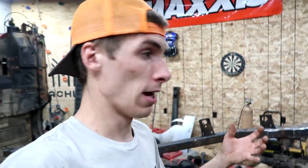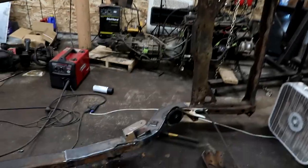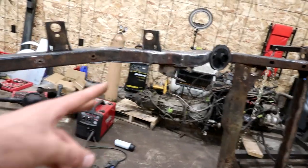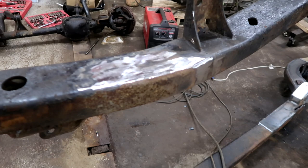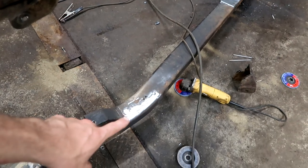Next day and it's raining again. Something I forgot to mention — I'm going with a long arm kit on my Jeep. Usually when you install these long arm kits you have everything together on your Jeep and you just cut off the four lower control arm mounts. Here's one of them right now — probably still hot. You cut off your two rears and your two fronts. The front was really easy — I got in there with my grinder and made it look decent. All four mounts are now off.